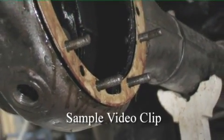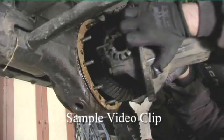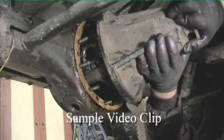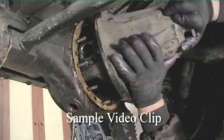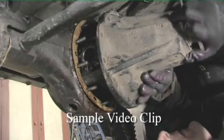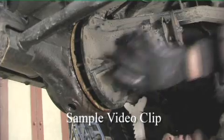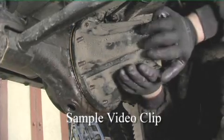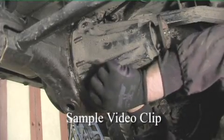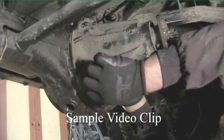With the gasket and the sealer in position, I can now proceed to insert a replacement differential. It's quite heavy so prepare yourself for it. And a little jiggery and we're in. It's good to have a bolt or a nut on standby — once it's in position, just to secure it, to stop it dropping back out again, because we don't want it falling out onto a hand or an arm.